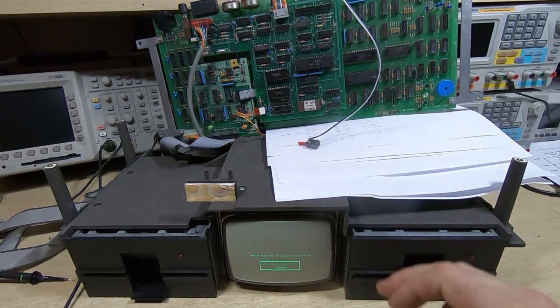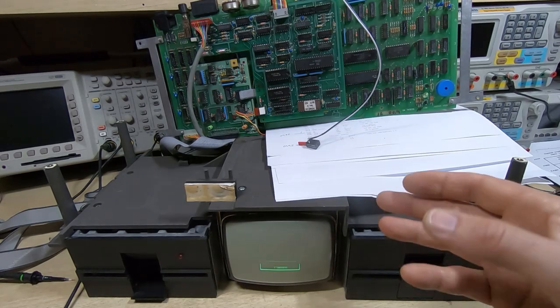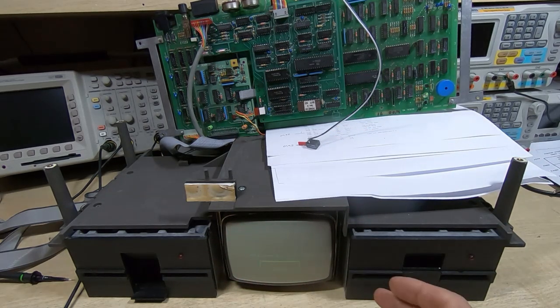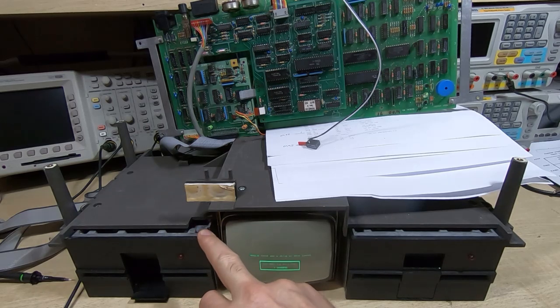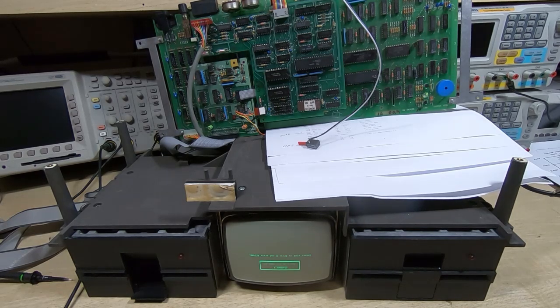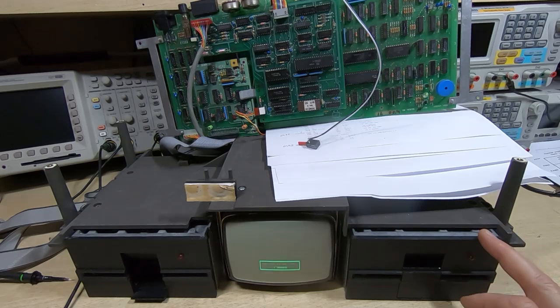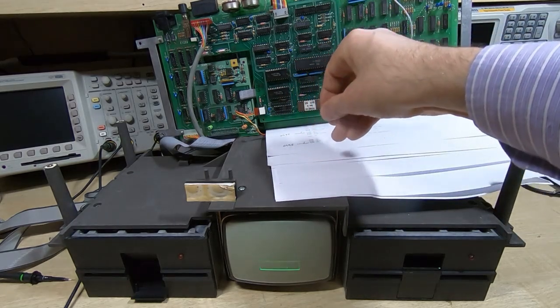I've replaced bit 7 as we saw, and when I first powered this up after reassembling everything it wouldn't run — the display wasn't showing anything and both drives were making very weird noises, so I quickly switched it off. It turns out drive B has developed a fault. I've got that unplugged at the moment and need to investigate that later. It's possible it didn't like what it was being asked to do when there was a fault during boot, since part of the information stored in low RAM is the drive information. I've also left the keyboard unplugged — I just want to see if we can get further beyond reading sectors 1 and 2.